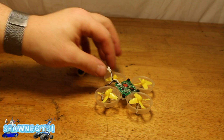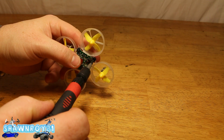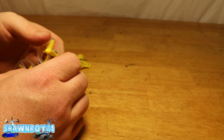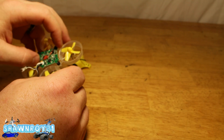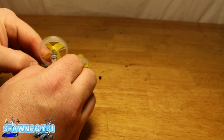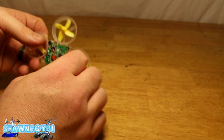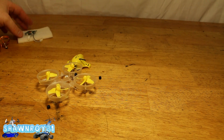Alright, so we're clear. We have one cable holding the camera assembly. Disconnect that and everything is free to go with the board. So 1 screw each side of that board, so 4 total. Releases the board, allows us to move it around. Alright, off the rubber grommets. So now we're going to disconnect the motors and make sure not to lose the little rubber elastic. It's going to keep the wire tension in there. So our board is free. Throw that to the side.